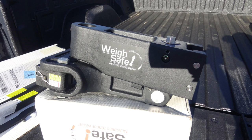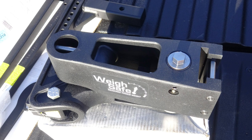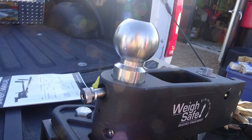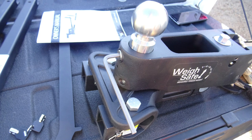This is what lifts the hitch up — solid steel, heavy-duty powder coated — and this is what lifts your arms up to level out your rig and lower your tongue weight. There's the main hitch head. This is the only system I know of that can dial in the tongue weight up or down with a wrench anywhere you are. The hitch head has interchangeable balls — two-inch and two-and-five-sixteenths — and it fits the adjustable shank. You do a bolt-in to hold the ball on top of the load cell, which is below the ball. That's a slotted ball so it can move up and down with the weight of your trailer. All heavy-duty, and it's greasable with three or four grease zerks for all moving parts.